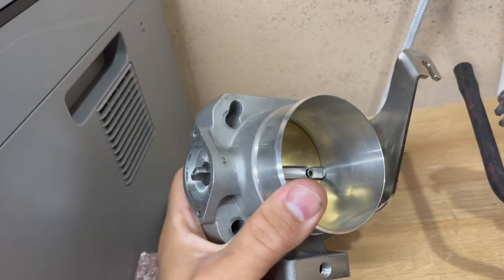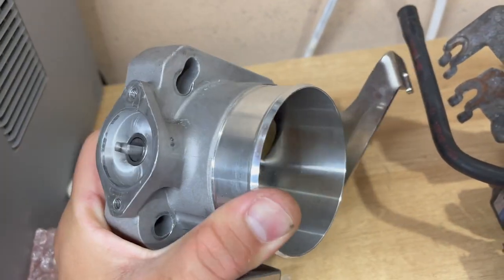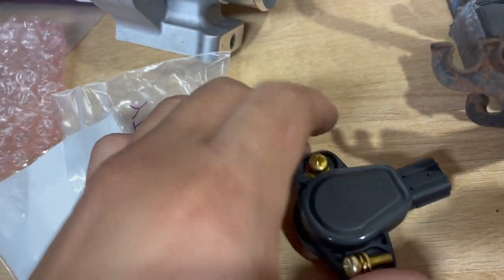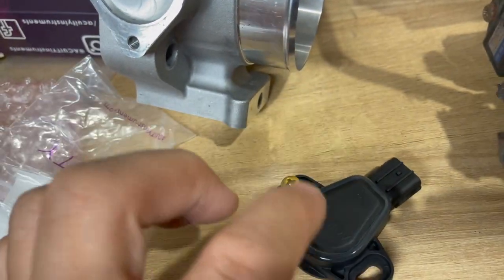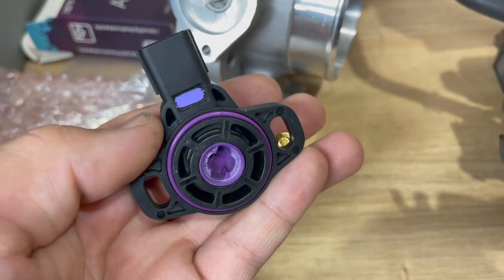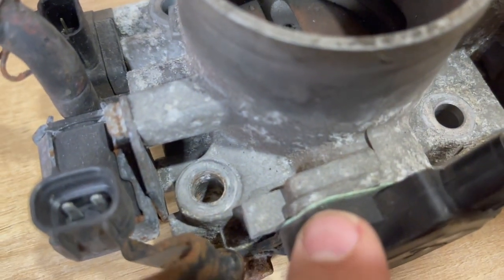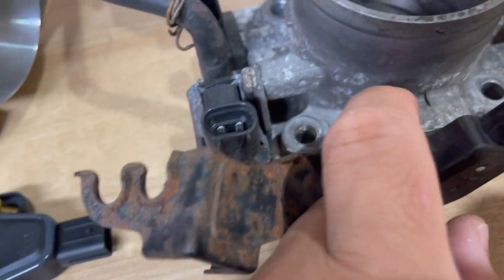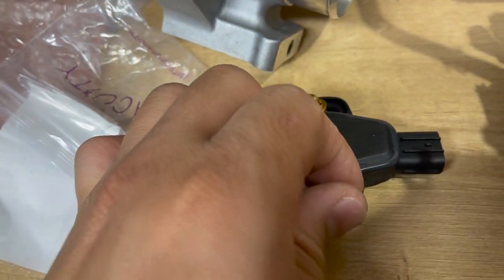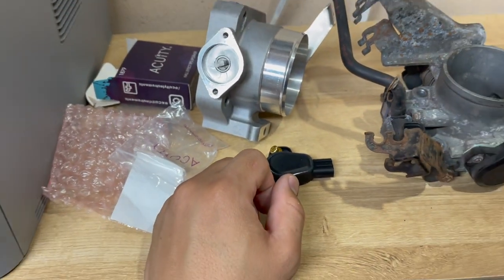Before I install this, let me show you how much of an effect a TPS has on your throttle response. When you open and close this, you guys see that notch right here - that goes into your TPS on the inside. If that's stuck or has some play and it's not perfect, you will have issues. It also has a rubber grommet on the inside which is a really good idea, because this one seems to have a paper one and those go bad eventually - maybe that's why TPS's fail.